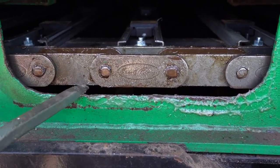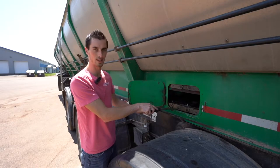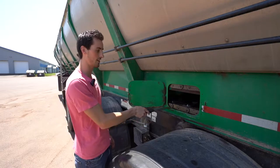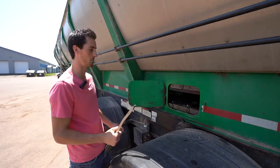If you pried it right here and this link and this link both pivoted upwards and it was just those links moving, that would mean your chain was way under tension. So basically you're looking to see if there's any pivot — if there's pivot, your chain probably needs some tension.